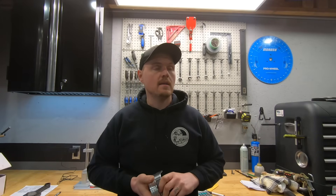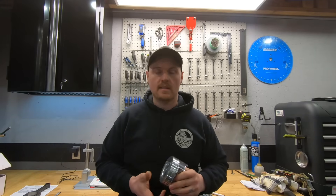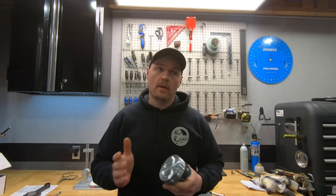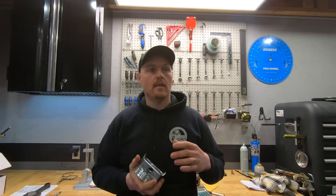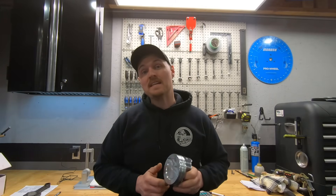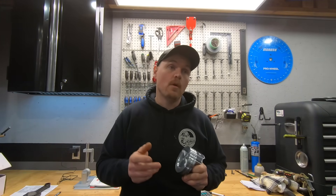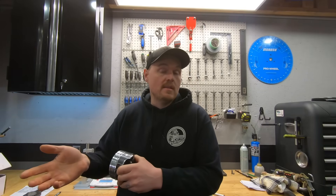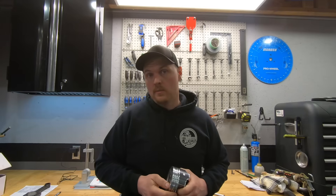We're going to talk more about bob weights in the next video. For example, I have the Dingle Ball 355 over there that has an aftermarket crankshaft — an Eagle crank, just a cast crank — and I was using stock rods and hypereutectic pistons. I figured it should have been close to the right bob weight, but I threw it on the balancer anyway. They called me up and said this thing is way out — it needs two slugs of Mallory. That balance job got really expensive; balancing that crankshaft cost me more than the actual crankshaft. But what would have sucked is putting that in the car and having to take it all back out because it was out way more than what you'd want.